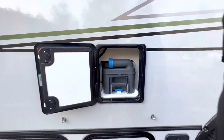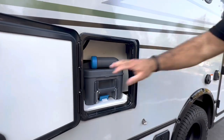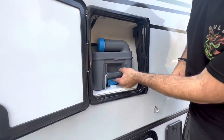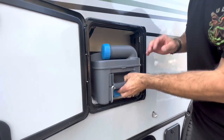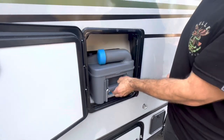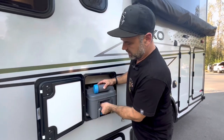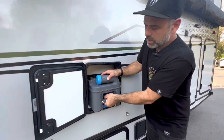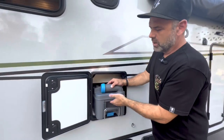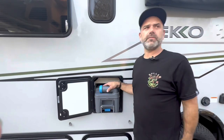Press the two buttons in, open it up — and there's the cassette we've all been talking about. Now everybody's demonstrated how this comes in and out. This little blue lever: you lift up to disengage, push it back in and it's locked. We're going to go ahead and extract it. There's an area to grab here and a handle here — this handle is probably more stable and easy to grab, especially if it's cold out, your hands are numb, or wet, because this thing could weigh 35-plus pounds when full.